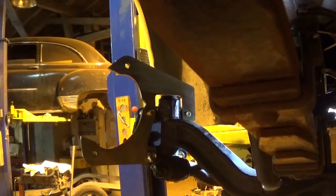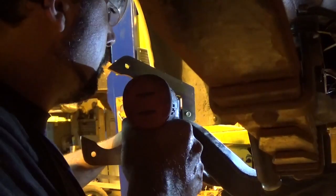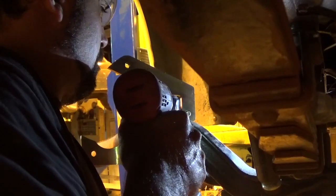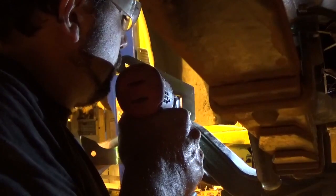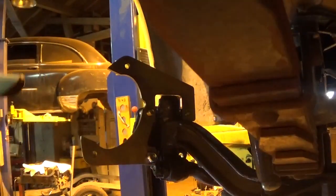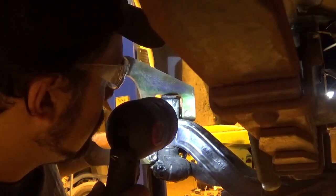It is kind of hard to drill through it. They tell you to keep drilling until the drill bit kisses the kingpin, because you won't be able to drill through the kingpin — it's hardened. It's kind of hard to drill that hole especially through the actual bushing. I switched out to an eighth-inch end mill when I got to the bushing and used the end mill to grind through it down to the actual kingpin surface. That could be hard to get through if you don't have the right tools.